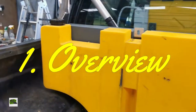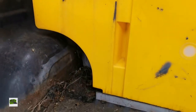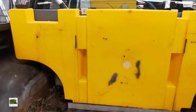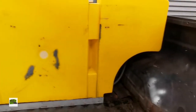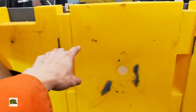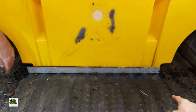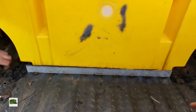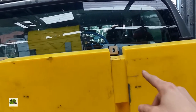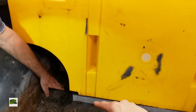Let me give you a first glimpse of what it looks like after probably around one to two years of usage. That obviously is a wheel arch auxiliary fuel tank, and it fits perfectly in between the two wheel arches. You probably need some RV accessories fittings — I don't remember the exact brand — but they've been really, really good products. You can actually get a fitting kit for the floor of the ute body, but this is a DIY sort of thing. You put an angle bracket there, fasten it, and find some ways on the top to fasten it too — bend a couple of flat bars and link them together to secure it.